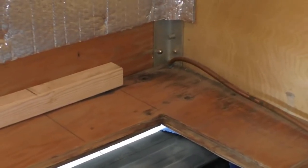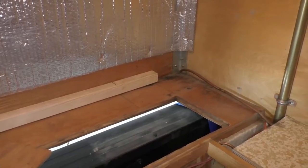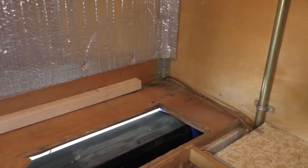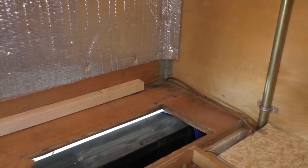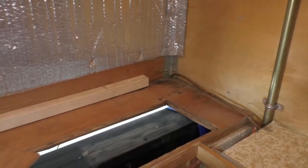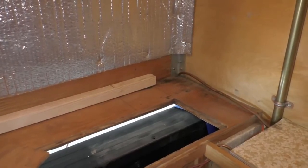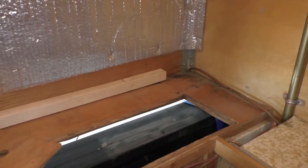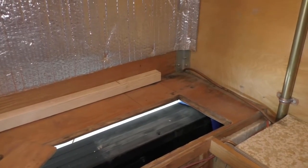The other thing is I laid out with these 2x2s in here, I set the cushions up for the dinette. It doesn't obstruct the cushions at all with the 2x2s in there when they're up, when they're in the 90 degree position. When you lay them out as a bed on each end, they tip up a little bit. I don't see a way around that. I could go with a shorter piece of wood, maybe a 1x2 that I laid in there and used liquid nails on. I don't know that I'd get the same structural support. And then they would come up, you know, just half as much. But with the as much as they tipped up on the ends, it really wasn't that significant. So I don't think it's really going to impact anybody's ability to sleep on this dinette when it's laid out as a bed. So there's my process, there's my thinking, and let's see how it goes.